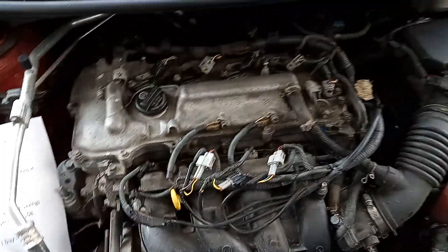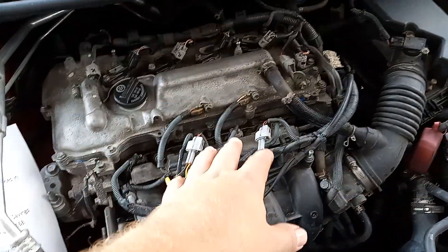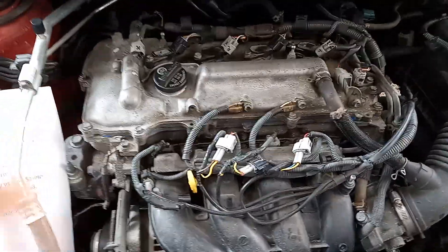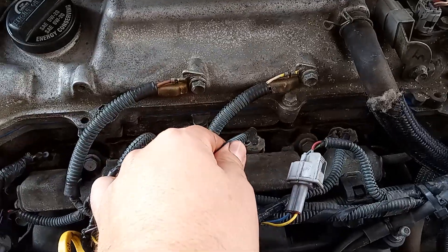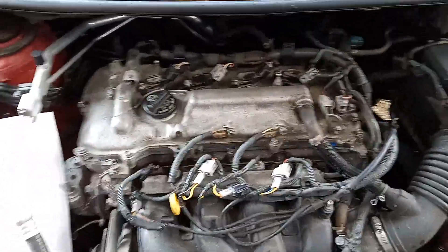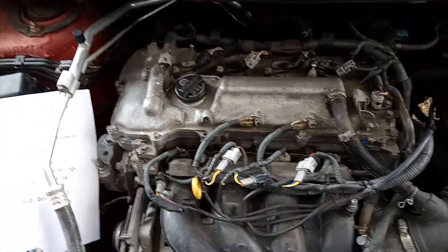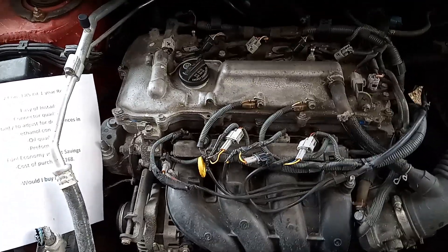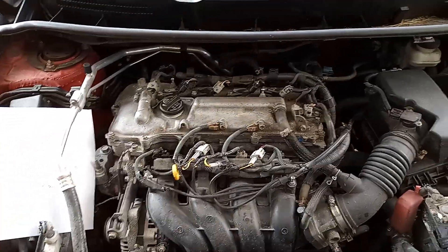The first thing I like is the ease of installation. You pretty much just unplug your injectors, plug those cables into the kit, mount the box, give it a ground, and you're done — it's all plug and play. The thing I don't like is that the plugs they use were really cheap. I wound up cutting those off and getting connectors from the junkyard — the pin fitment wasn't good enough and they weren't waterproof. I'd recommend buying the kit without connectors and sourcing your own from the junkyard if you can.